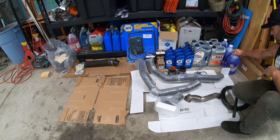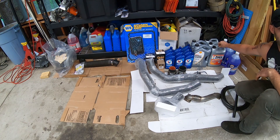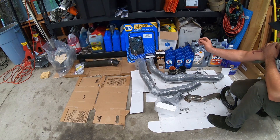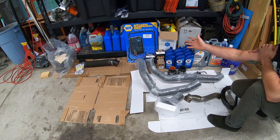For the long trip, I picked up three gallons of windshield washing fluid. Going to do a complete exchange on the cooling system, oil change, picked up a bunch of trans fluid, fuel filter, oil filter, trans filter - spin-on and a new internal because I haven't done that yet.